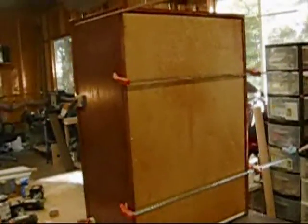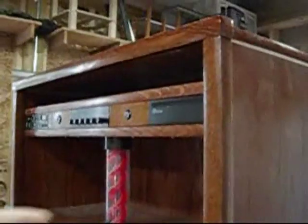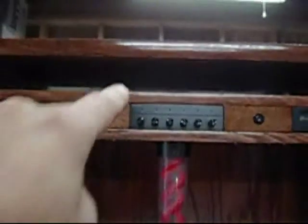Right now I've just got six screws in the removable back, but it'll have a few more. And that creates the venting — there's a top vent and a bottom vent. So through the bottom vent, air gets drawn up from the fixed back, between the fixed back and the removable back, back to this opening here for a triple radiator. The radiator will draw through the cabinet and then it passes up and comes out the top vent.